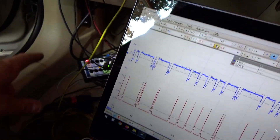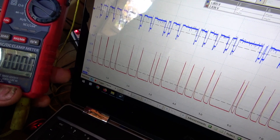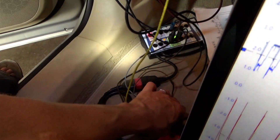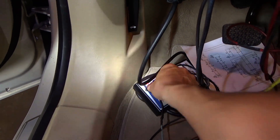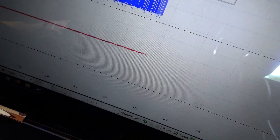Channel 2 is on the 12-volt feed at the sensor. It's trying to bump up to 12 volts but can't quite do it — it kind of bumps up and decays. Putting a test light on there from battery positive shows no short to ground, keeps it at 12 volts, good communication. Everything's happy with the test light plugged in.